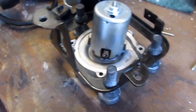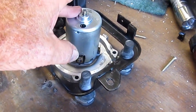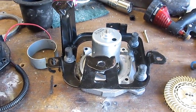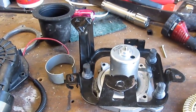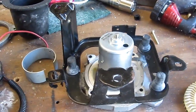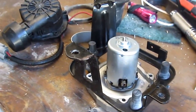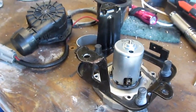What I did was unplug the motor and also unplug the diaphragm. The light stays on, but remember, the diaphragm I had is a normally closed diaphragm — it does not allow air to leak through it. If it stays closed, I see no reason why I couldn't just go ahead and run. If it opened up, we'd probably have a rough running engine. I've got them both unhooked and I've been running for about two weeks now. I don't see any difference, and mileage hasn't noticeably gone down.